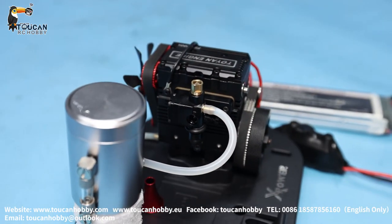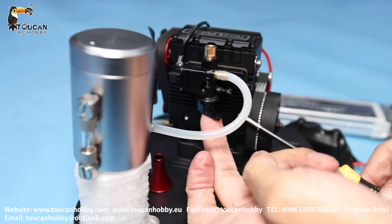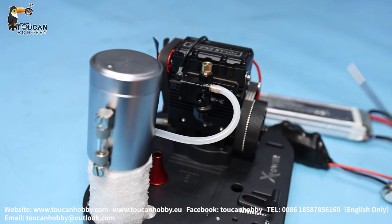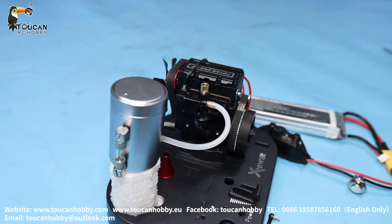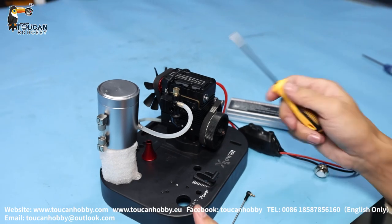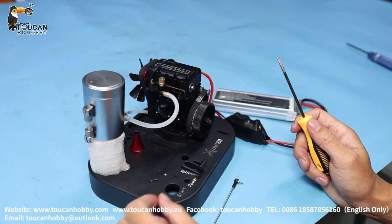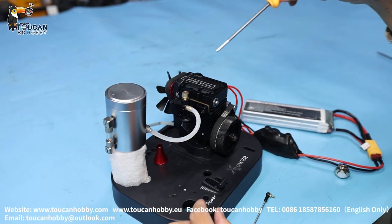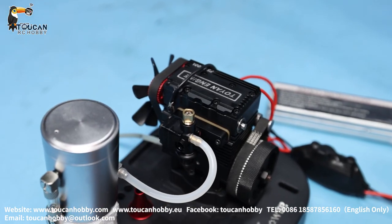This one's downside is the auxiliary needle. The auxiliary needle screw is from the bottom. If you have to adjust, you have to take out this one, so you can put the screw there to adjust. This one I already closed. The main oil needle is also almost closed, only cracked open. The carburetor from each engine — single-cylinder, two-cylinder, four-cylinder — the carburetor are really different from engine to engine. Even the same type, so when you're adjusting, what I'm doing is only for reference. How to adjust your engine's carburetor or needle, you have to slowly adjust to find the best position to start your engine.